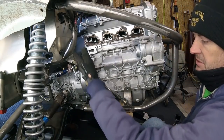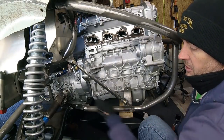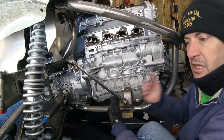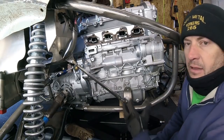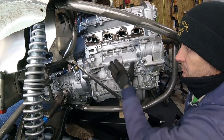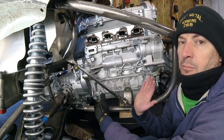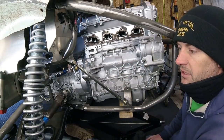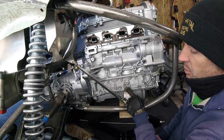We're right back. If I had done it the other way, I would have designed the chassis longer to integrate the motor mounts onto the chassis and eliminate the engine cage. I'm not saying this needs to be done on every chassis — I'm just saying that because I originally designed this for air-cooled and have since gone with water-cooled, I have to add this extra support to pull everything up so nothing's sagging. Without these, I can't get proper tension on this bolt.